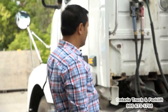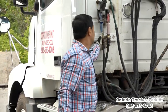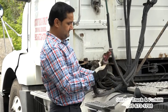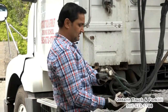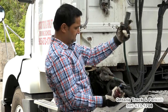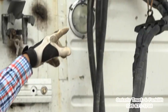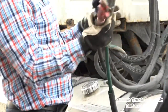Now we put our four-way flashes on and come out to do the inspection on the coupling system. First, we will check our glad hands — there are no cuts, no damages on them, and the O-rings are in good shape. Check the electrical plug: no cuts, no damage, no rust or dust inside the pins. We'll check all the lines — there are no cracks or damages, they are hanging properly and attached to the tractor. Now we're going to secure them back.